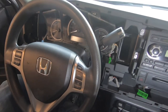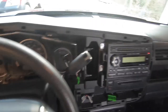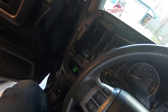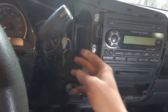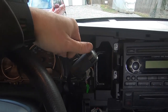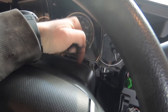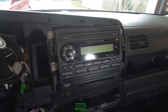To get the dash panel off — it goes around the whole dash — there are no screws, it's just clipped on. Start on one side; you'll feel a little tab and use a pry tool, a butter knife, or something similar. Work it loose and disconnect the harnesses. You'll need to put the steering wheel in the lowest position, drop the wheel, put it in gear, and put the emergency brake on. There's also an emergency release to allow you to engage your shifter — just stick a key in that little cover and pull it down.